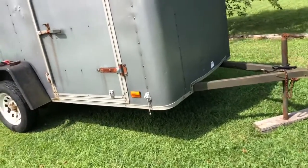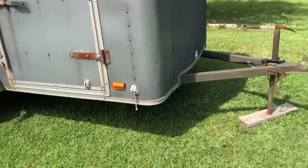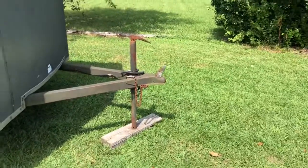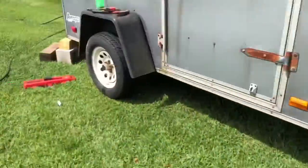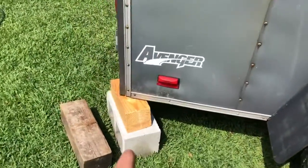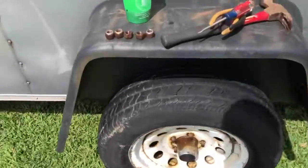I'm going to show you a little trick I learned. I got to do bearings on this trailer. A trick that works pretty good with short trailers like this: you lower the jack all the way down, then go to the back corner of the trailer, put a couple blocks under it, then you can use the jack to jack it up — right now I can spin the wheels.